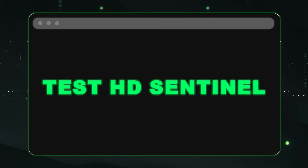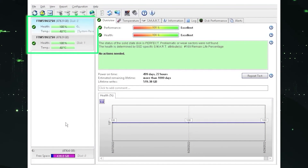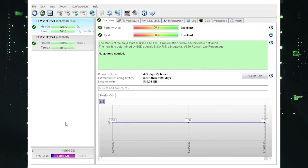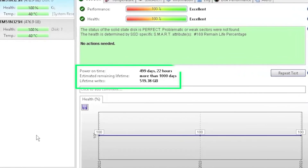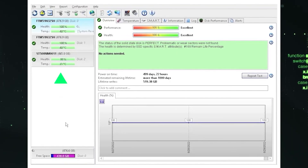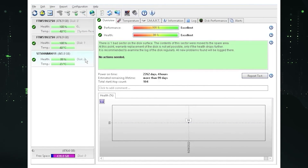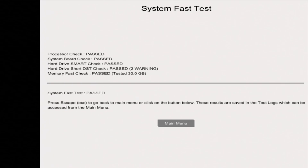I have HD Sentinel pulled up right now. As you can see, we currently have two drives plugged in, installed into a storage array where we like to plug in multiple drives at a time. HD Sentinel is an awesome tool — you can see things like the power-on hours, which is great when buying used equipment so you can see how long that drive has been in use. You don't want drives that have been heavily used because that means higher risk of failure. It'll automatically populate when you plug a drive into the array and give you health scores. The two drives at the top have a 100% health score, while the one at the bottom has 99% — all pretty good. You've successfully tested your drives and your server as a whole.